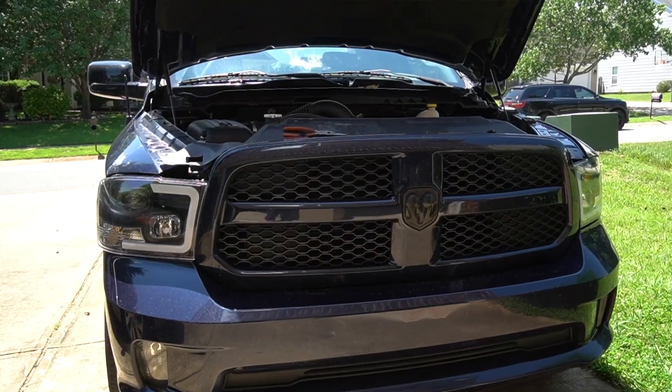So I ran into a little problem. As you may or may not know, I changed my headlights to the OLED, and apparently the OLED takes an H7 bulb. Previously I wanted to put in these R3 H11s — so if you have stock quads, this is what you'd really need. I had to purchase different ones because I got the OLED, and those H11s don't fit. So if you guys got the OLED, I'll save you the time: you need the H7. I could not find the Hikari in H7, which really stinks because I really wanted those.